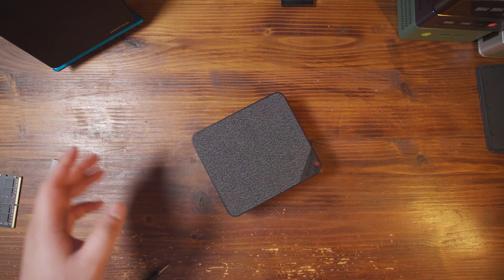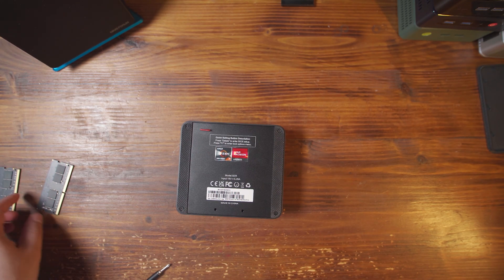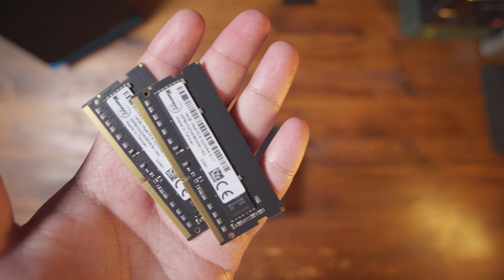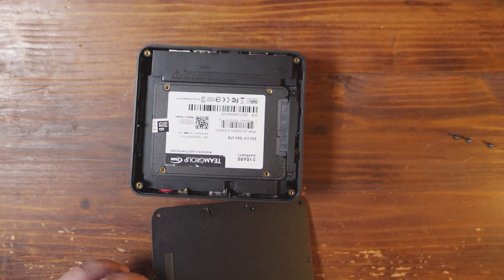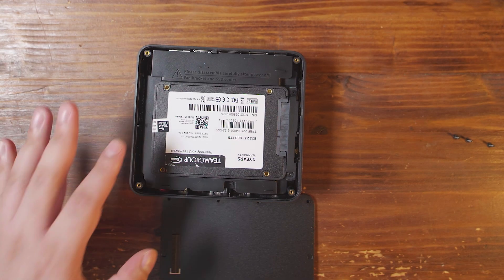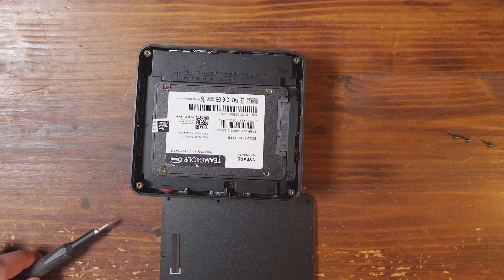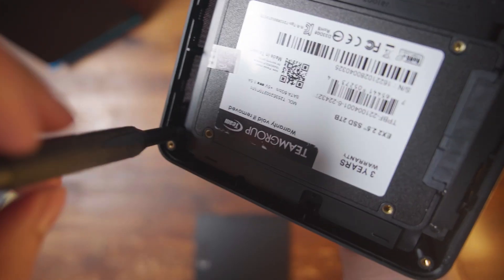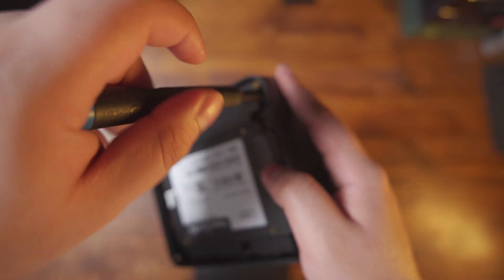I just finished all the testing with 16GB of memory, so now I'm going to upgrade this thing to 32GB. Thankfully, this Beelink system makes it extremely easy. We're going to be putting in this 32GB kit. All you have to do is unscrew these four screws and then use the pull tab. Once you use the pull tab, you can see that we have the shroud that holds the SATA SSD. All you have to do is go for two screws on the sides and then one in the middle. They're kind of recessed in there, so they're a little bit of a pain to get a grip on, but once you're in there you can just pull it out. Using a screwdriver with a magnetic tip is pretty much essential.